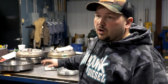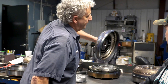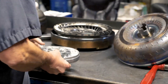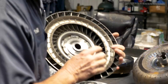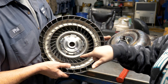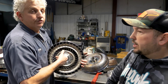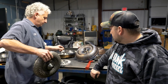That's how a torque converter goes together — it's really fairly simple. The main things that can go wrong are either ballooning, where the turbine and pump make contact, or an install issue. That's a sprag eliminator — that's for a race application. That seal right in there — a lot of times they can be aggravating to get on. That's where the tip of the input shaft seals. So if you're fighting a converter onto the input shaft and you're too rough with it, you can push that seal off and have a brand new torque converter that doesn't have full lockup because it's not sealing up on the tip of the input — even if you just nick it ever so slightly. That's why you want to just roll a torque converter onto the input shaft without fighting it.